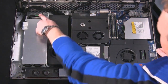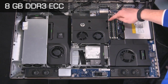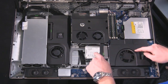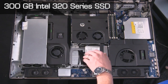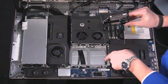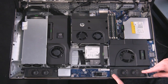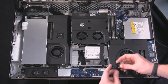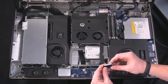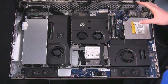We have a 400-watt power supply that is removable as well, at 90% efficiency. The whole system actually runs very quietly. We have eight gigs of memory with four DIMM slots, upgradable up to 32 gigs. There's a Blu-ray drive here. For storage, we have an Intel 320 Series 300 GB SSD, also easily removable. On the sled there's room for a second 2.5-inch drive matching those hot-swap bays — another upgrade path option. There's also a regular USB connection used for HP's included keyboard and mouse dongle, so if you want to upgrade your keyboard, you can just put your own USB dongle in there without anything external to the system.